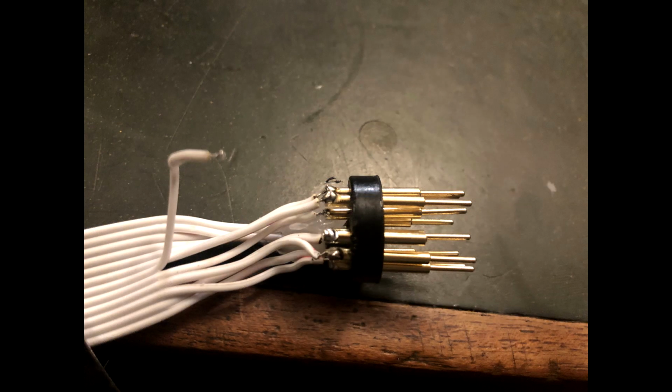Desolder the wire from your broken pin. Use the minimum amount of heat necessary to do it so that you don't melt the plastic. It would then be easiest to snip the soldery end of your broken pin before sliding it out, forwards like you did with your chosen replacement.